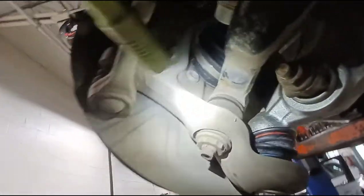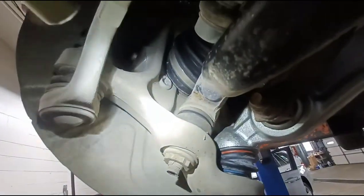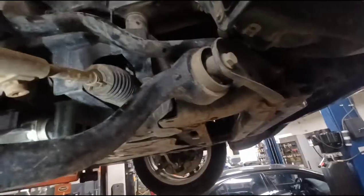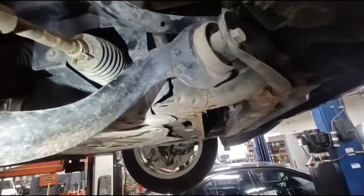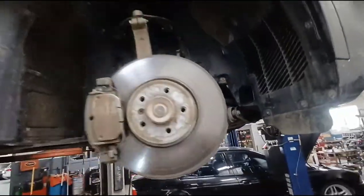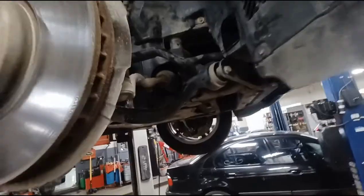But this one actually the ball joint's bad. It's kind of hard to check in place without the weight of the car pushing on it, but you can sometimes squeeze them with channel locks and pry around and get them to show a little bit of movement in the ball joint. Usually on these arms it ends up being the bushing that's failed. But if you can play the noise with the brake pedal at low speed, get it to clunk, and it feels like the front is shifting — you can actually see, if you have another person watching the outside of the car while you're stabbing the brake pedal, the whole wheel is shifting. It's usually gonna end up being this arm. Just something to look for on your BMW.